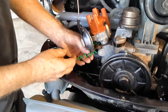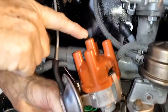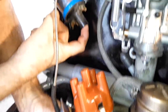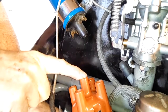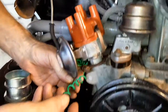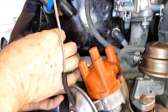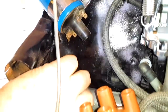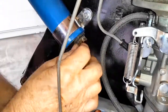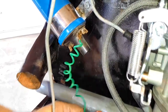The electrical connection, besides the big plug wires, is the center wire — that's the high tension wire carrying 25,000 volts from the center of the coil to the center of the distributor. The only other connection from the distributor is the 12-volt primary coming from the condenser, and it goes right up here and hooks right there. You've got your choice — you can hook it in the back or hook it in the front.